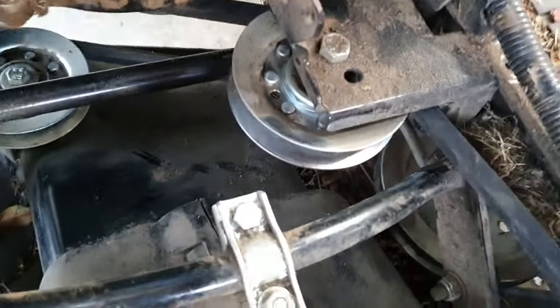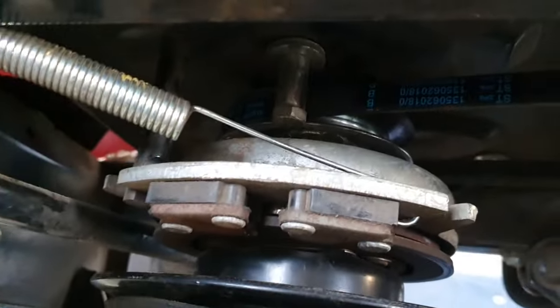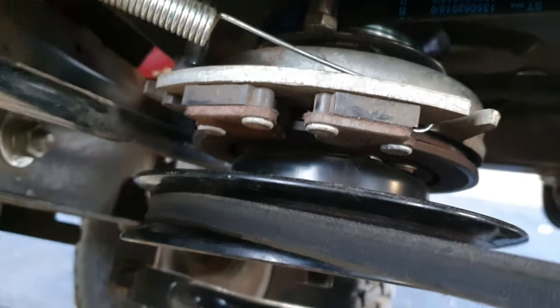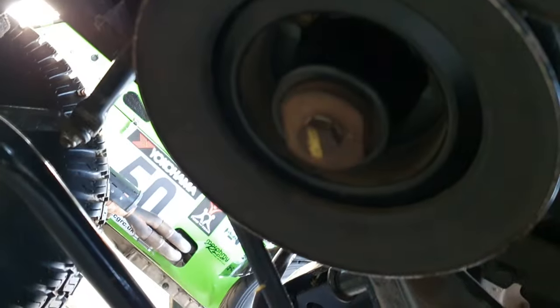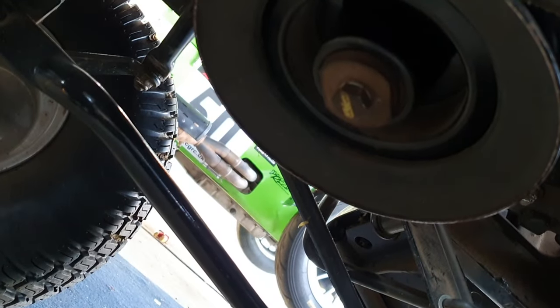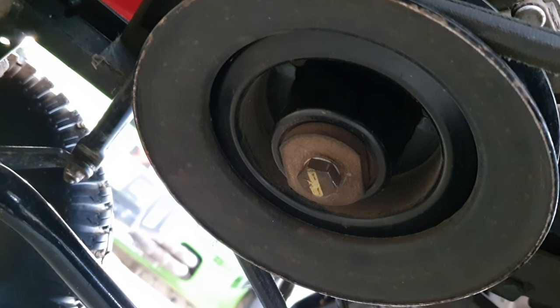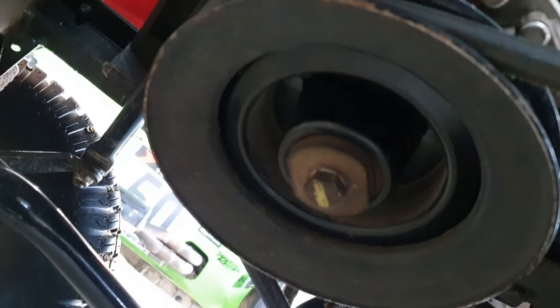The next pulley — the belt just needs to go around the back of that; there's no guard on it so you don't need to do anything with it. Then to release the belt from the main engine pulley you need to remove this spring. There are also two electrical connectors for the clutch on the other side that you need to remove. Then drop the whole assembly out — on the bottom there's a 16mm bolt, it undoes anti-clockwise like any other bolt. Use an impact driver; if you don't have one you'll need a big adjustable and put it on the concentric washer above it, otherwise you'll just be turning the engine when you try to undo it.